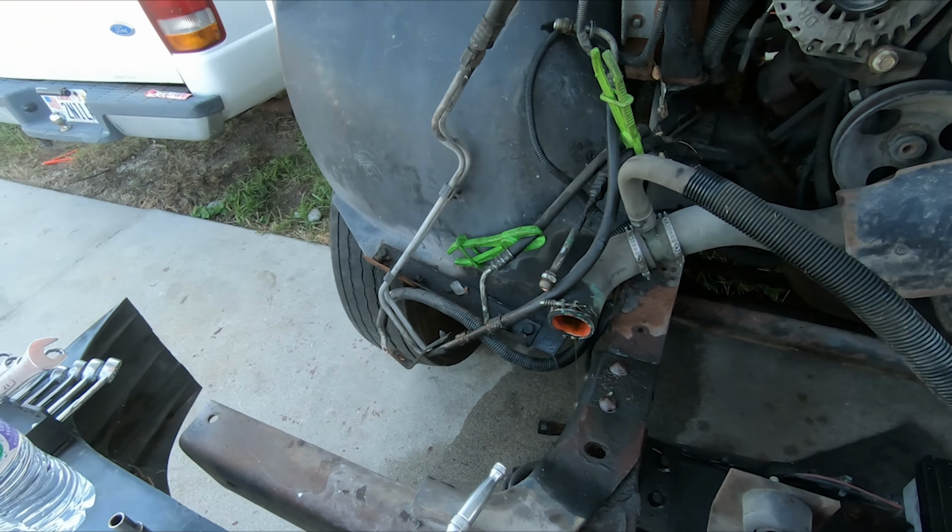I'll show you. Look right here, oil cooler lines disconnected down by the oil filter. Everything here, this wires, all the glow plugs, that connector, just all connected, stuck to the block, same as this. Crank signal, I'm sure, just goes down inside that crankcase there. On this side, same thing. Right here, a couple wires, but they're all stuck to the block. Down there, that wire doesn't touch the engine.